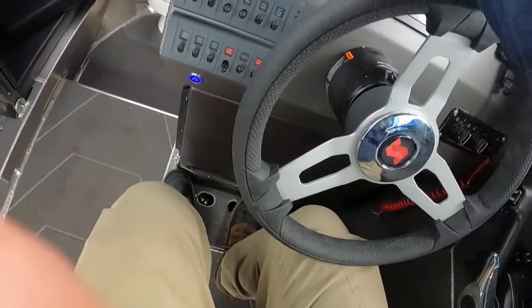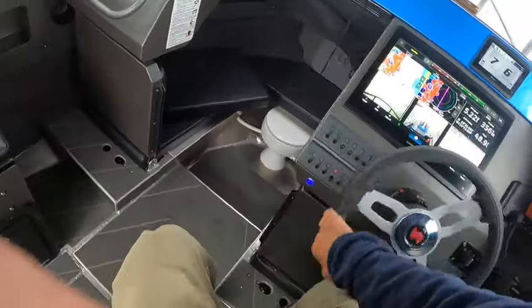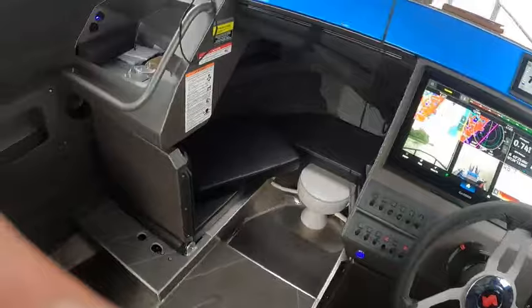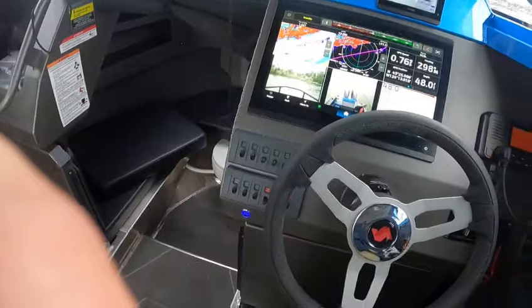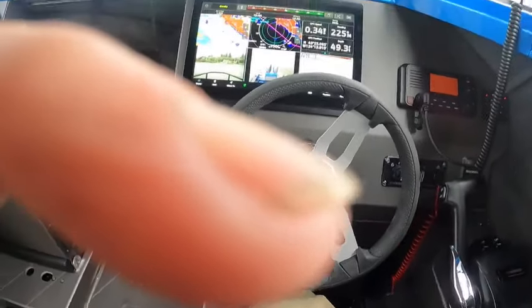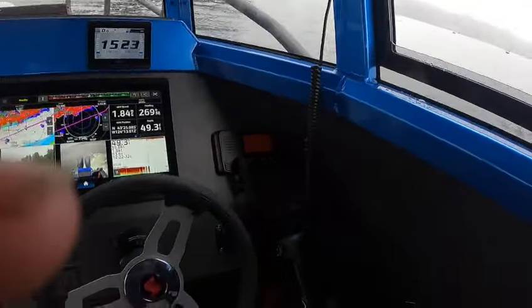Now I'm going to shut that off again. Say I'm going to go to the left — I bring this one back to the left just to where it stops the boat, then I just do the starboard motor and you can sit and spin it. If you want to go a little faster, just help it by turning the wheel to the left. If I want to go the other way, bring these back into neutral, turn the wheel to the right, bring your starboard motor back, hit it, throw that port one forward — there you go and there you're spinning.